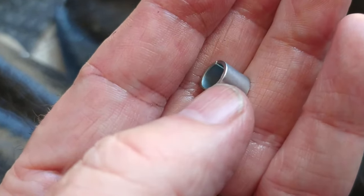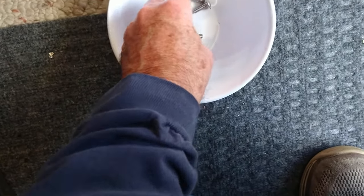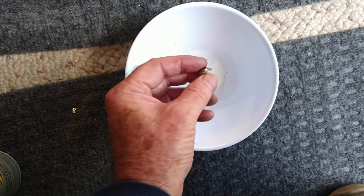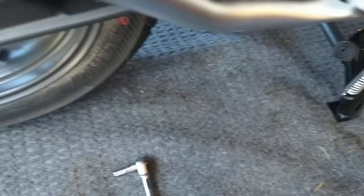If that's not enough, you can use a little pair of pliers to kind of squeeze it on — just like that. Next we're going to go to the other side and loosen up this nut right here, and we'll be replacing it with a longer one from the package. There are only three bolts left with supplied hardware. One of them is longer than the other two. The two shorter ones will go on the chain guard side, and the longer one will go over to the other side where the brake line is. I recommend getting these two just started to hold things in place, but actually do the other one first because it needs to wiggle around just a little bit.